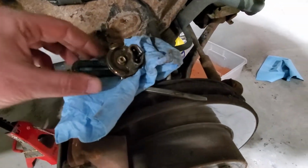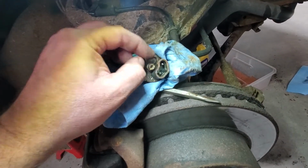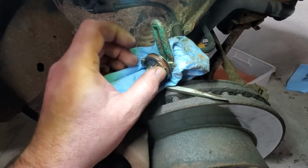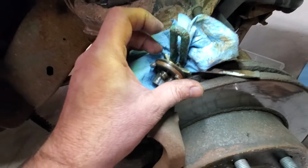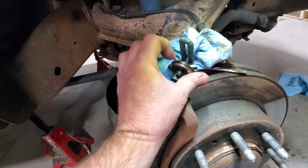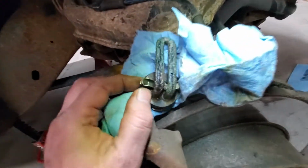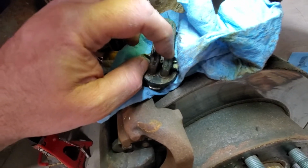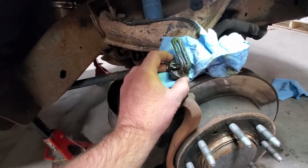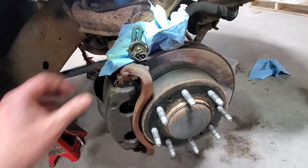You can see on this guy here, and this is the factory original, this brass screw was really screwed up, but I eventually got it to spin, because it just goes into one of the Welch plugs, and these little ears pull in, and then it pulls it against the block, and they bend in and it holds it in, and this O-ring is what seals it. Well, if you look on the back side here, you can see it finally corroded away. And as soon as it did that, now the water, being slightly conductive, going from here to here, just shorts this out, and it doesn't work anymore. It stopped being a block heater. So that's what I'm doing.